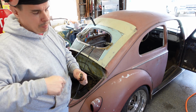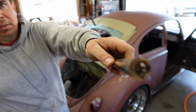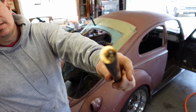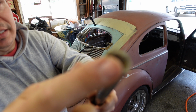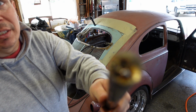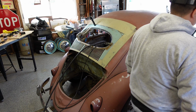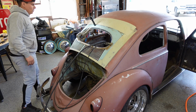Between each of the plug welds, every so often you're going to get some dirt and stuff like that on the tip of your brass, so you want to clean that off. Otherwise, this is something that your welds will stick to, and you don't want it to stick to, so just go through it and clean that off. There you go. In between, I just go over with the little grinding wheel, clean it up, and then you have something again to use that your weld's not going to stick to.